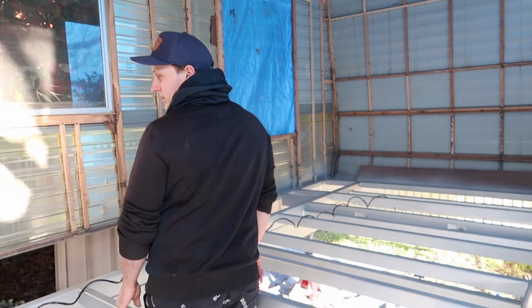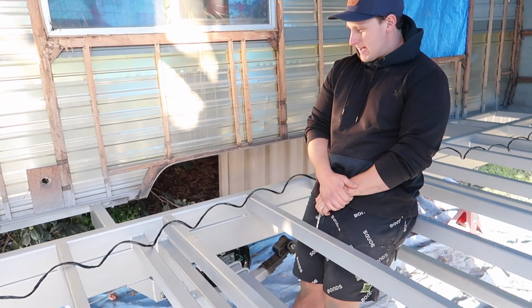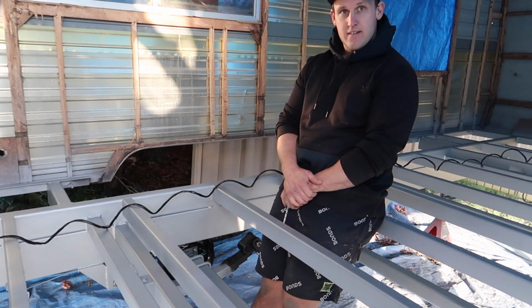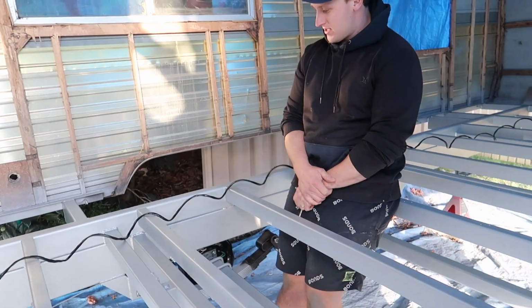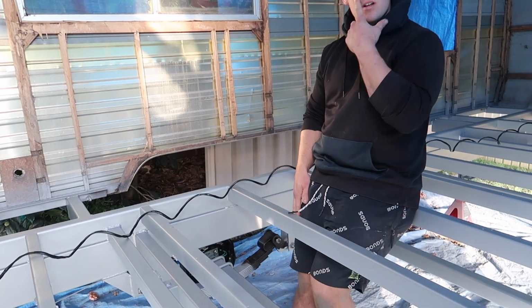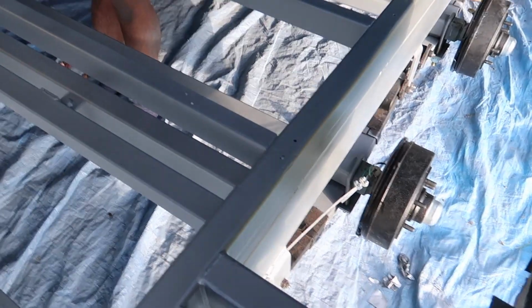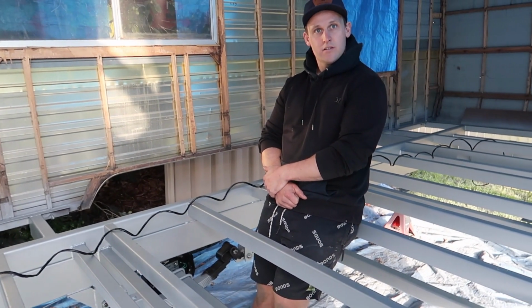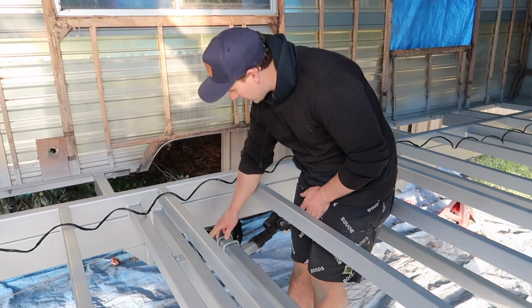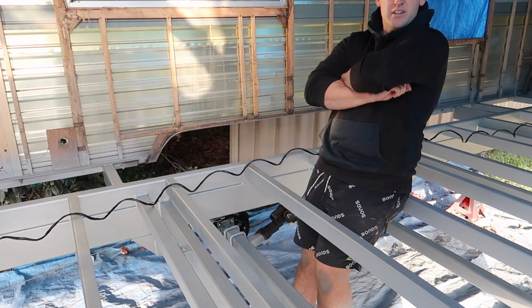Now, I'm just deciding whether to run my cable along the side of the chassis, or inside underneath it. Inside it. And then come out where? Were you going to poke a hole in it? Drill a hole there. But what about movement? Well, the wheels move, don't they? Like with your suspension. Yeah, that's right. So there'll have to be a bit of slack. Okay. So you just come out and then protect it with that flexi conduit, yeah.